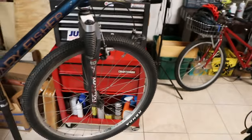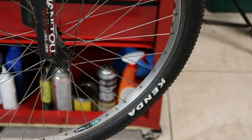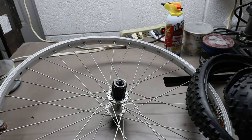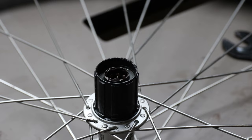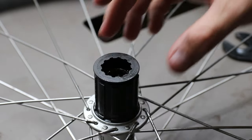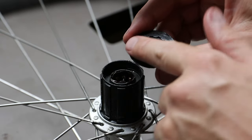It's not a bad-looking tire either, but it totally doesn't match the front tire, which is a Kenda. That's going to be the nature of this bike — it's kind of a misfit bike. It turns out that dust cap goes down in here, not out on the top, because this final lock piece needs to thread into the hub body. So that goes down in there, not up here. That means I had to take everything apart and the whole axle had to come out.